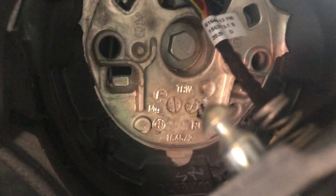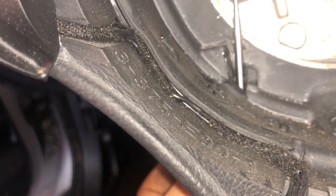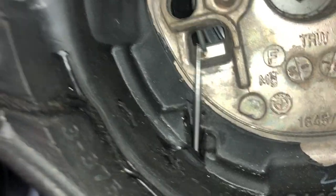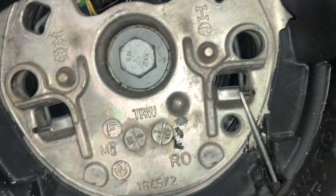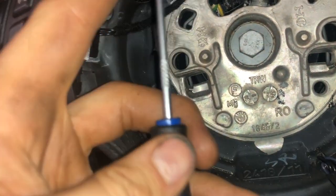I got the latches released. Basically you come up through the hole in the side here, and then you're trying to fish around — the hole comes right up in front of this plate. If you're too far back it won't go in, if you're too far forward you hit the airbag. So you come up pretty much straight and you'll feel the clip and then just push that in and it releases the airbag. It took me like 10 minutes just to find that clip. Same thing on the other side — fish around until you find it and then push in. I just use a little pick.